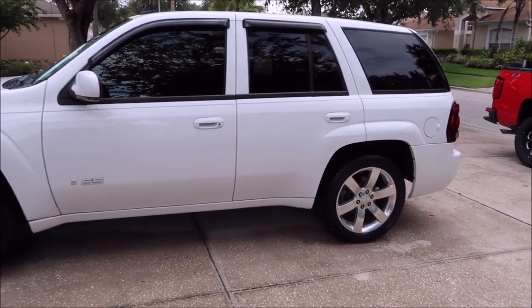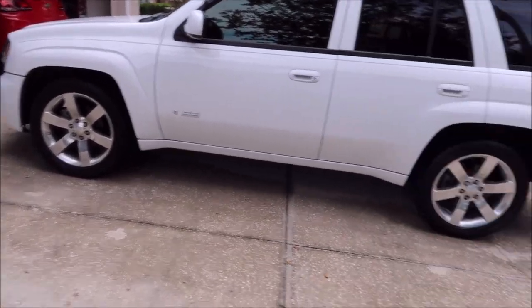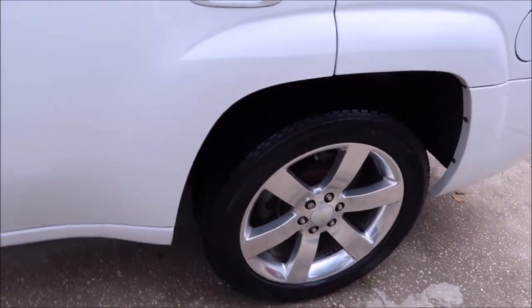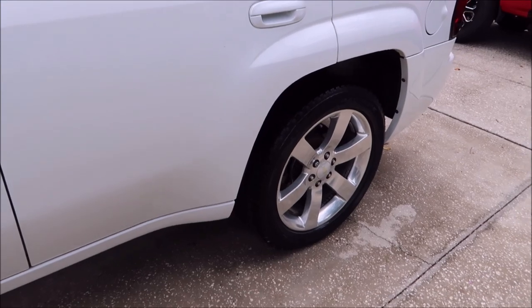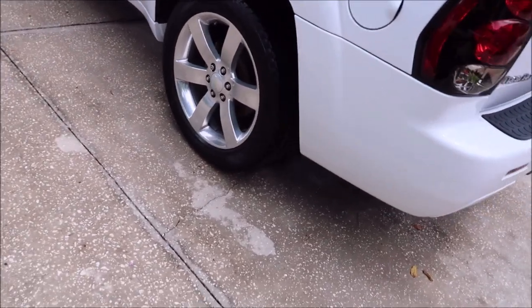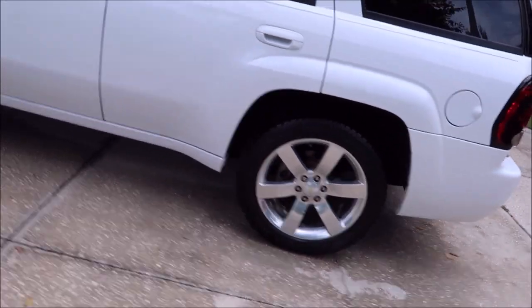After the Universal All-in-One, we did a Universal Clean and Prep wipe down of the whole vehicle and cleaned the wheels with Universal Clean and Prep as well. For the tires, I used Universal Dressing from the One System — sprayed directly on — at one part product to seven parts water. I put two ounces in a 16-ounce bottle, filled it up with water, shook it up, sprayed it on, and left it. It lays down really nice and even.